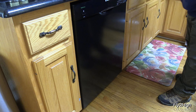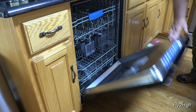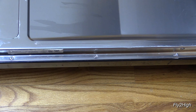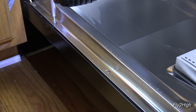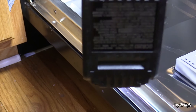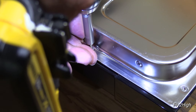First, I'll remove the door's sheet metal lower cover. Open the washer's door full open. Along each side, there are three sheet metal screws — three here on the left, and three more on the right. Using that T20 Torx driver, remove all six.